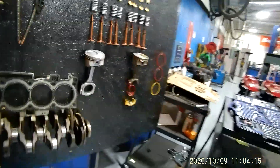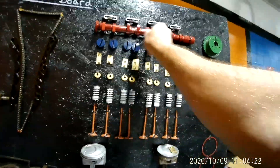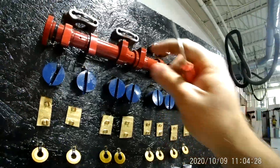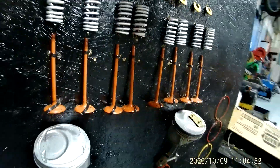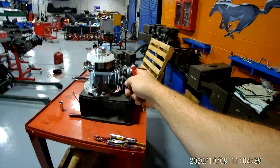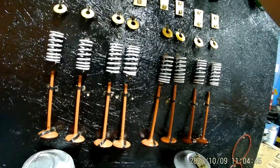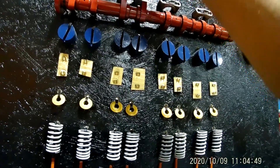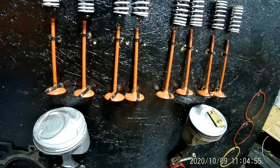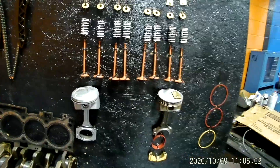If you look on this board right here, here is the red thing — this is your camshaft. And if you can look and see, that camshaft has lobes on it, and they're kind of egg-shaped. What happens is if you have a push rod style engine like this one right here — it's got push rods — then this cam lobe rides on a push rod. And once it comes around, it pushes that push rod up, hits the rocker arm, and pushes the valve down. That's how it opens the valve. Then as it cycles through, the spring pulls the valve shut.